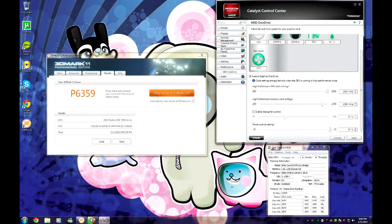Now for some benchmark results. Our test bed is using a Core i5-3470 CPU running at 3.8GHz coupled with 8GB of DDR3 RAM. This particular 7850 achieved a core clock of 1050MHz, up from 860MHz, and 1350MHz on the memory, up from 1200MHz. As a result we were able to score 6359 points in 3DMark 11 on the performance setting, and 1438 on the extreme setting. Do note overclocking results can vary from card to card and you may not achieve these clock speeds. During testing the card remained quiet under full load and did not exceed temperatures of 60 degrees.